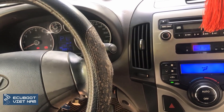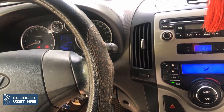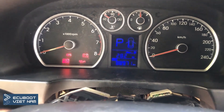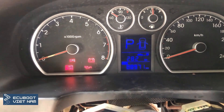There are a bunch of lights on the instrument panel dedicated to the EPS system, the handbrake, as well as the battery. So let's give it a crank to see what happens. As you can see, the problem is confirmed — we have no crank and it's very hard to steer.